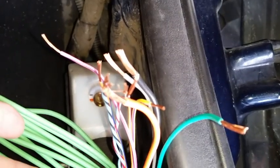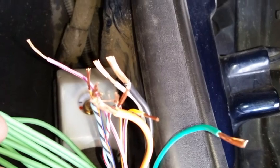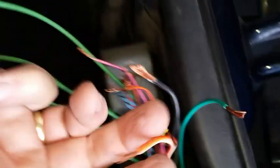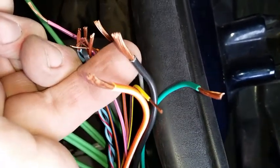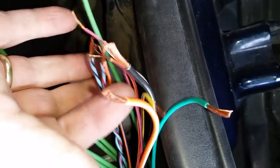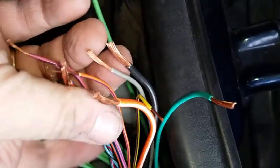I'm going to use a meter, but you could use, again, a battery-powered test light. It needs to be battery-powered because the power to the Jeep has been disconnected at the battery terminal, and you know why, because you've got a bunch of bare wires hanging here. This is the power wire. These are the two 12 gauge power wires, and the ground is black, and it's the same colors on the driver's side. So you don't want those to short out. You want the battery disconnected because you've got a bunch of stuff hanging here that could get damaged if it got to the power wire.